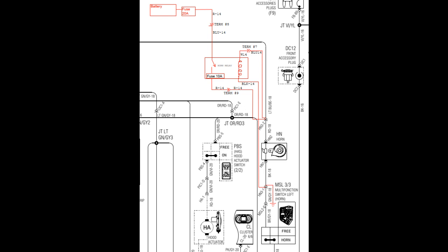You'll notice on the drawing on my relay I have a 10-amp fuse — that's because I'm using a relay that has a built-in fuse to it. On the normally open contact of the relay, run a 14-gauge wire over to the positive side of the horn. These horns are polarity sensitive, so please make sure you get on the positive side. The negative side of the horn will now go directly to ground. One thing not shown on the drawing is we are actually hooking up two horns, so those horns have to be hooked up in parallel.